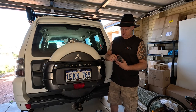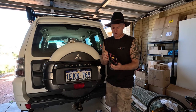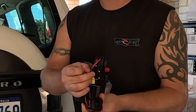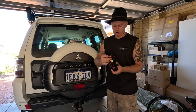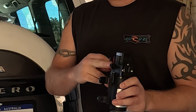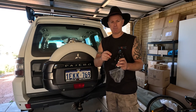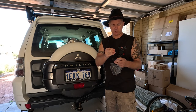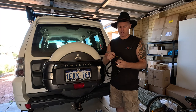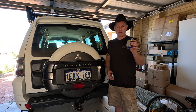The first thing I noticed was — so this is the water pump here. As you can see, all the wiring is just a positive and negative but it's just loose wires. So obviously I'm going to have to figure out a way to connect it up. Now, the other issue is where the hose clips on — on both sides it's actually not like a regular size garden hose, so I actually had to get some different size hose for that as well. You may already have a gas bottle with the newer fitting, but with these ones here it's actually the bigger one. So for the water pump, I'm actually going to solder this one up and connect it via Anderson plug.